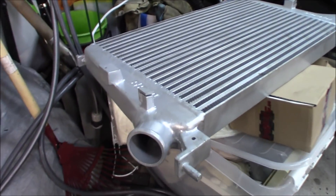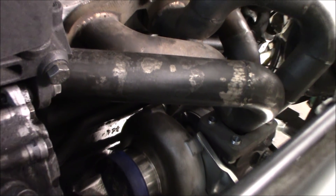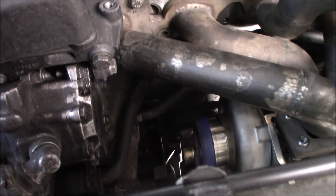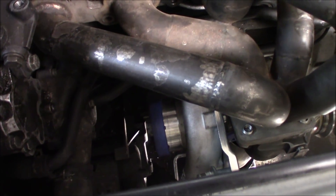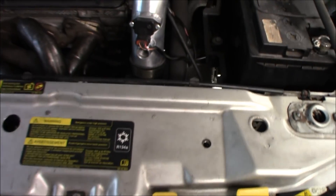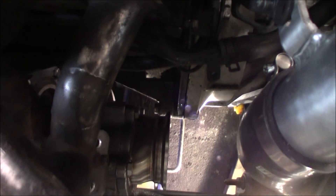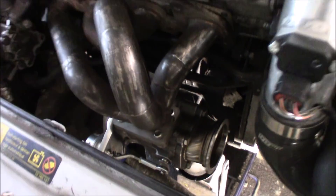I'm going to install the turbo as close to the block as I can. The inlet is quite tight but I know that DO88 has Cobra intakes that would be very well suited for this, or maybe a 90-degree elbow - either one should work pretty well. The V-band is lining up really good so I don't think there would be any problem doing a down pipe out of this. I think this will be a really nice setup.